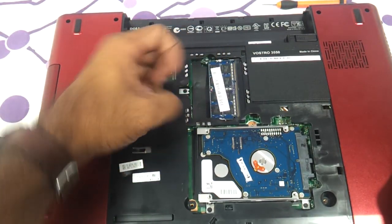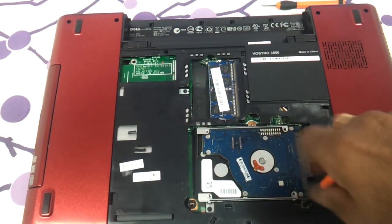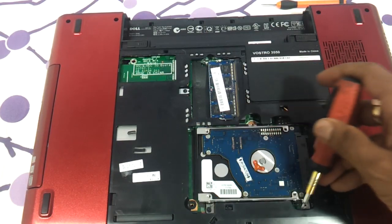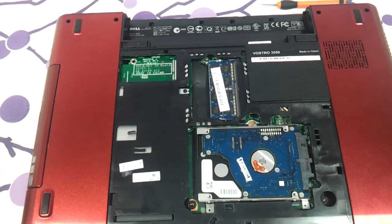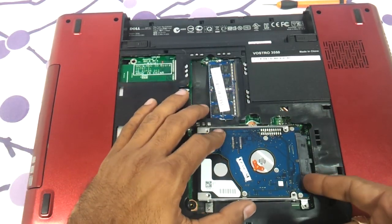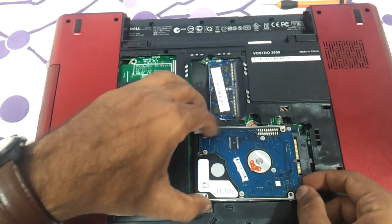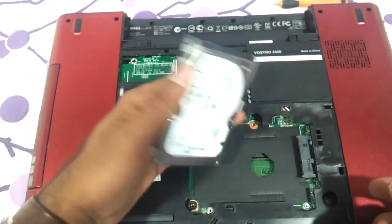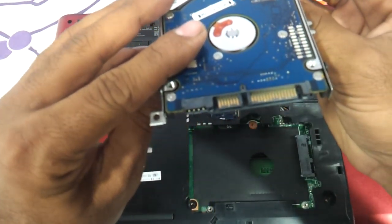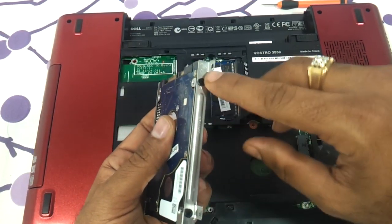The notches will hold the RAM in place. For the hard drive, you just need to remove these two screws and slide it out to the left. You now have the hard disk in hand — it uses a SATA interface. You can use a 500GB, 750GB, or in some cases a 1TB hard drive. Remove the four screws holding the bracket on to the drive.